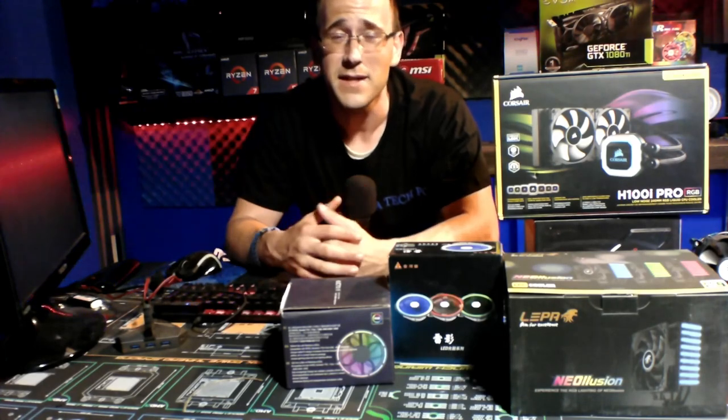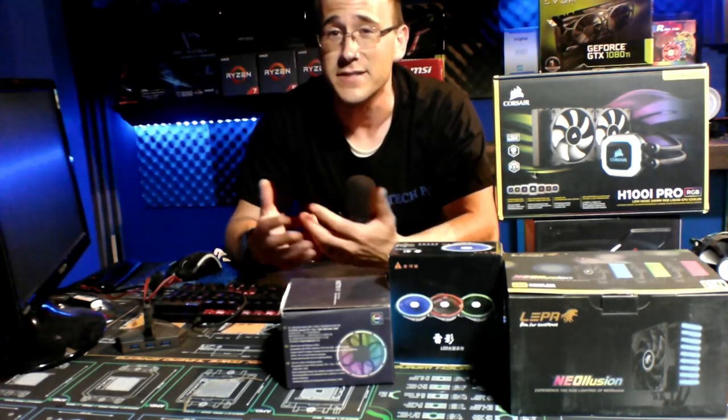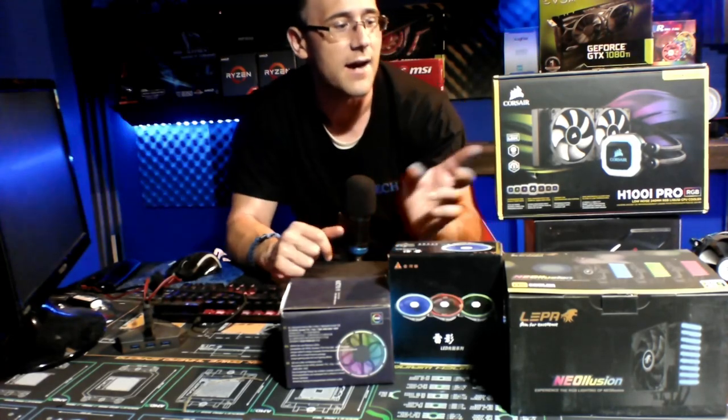Not really, because you can still buy a $50, $40, or $30 CPU cooler and still get the same results. Unless you might be going into, you know, an AIO. But the thing with AIOs is that a 240 millimeter rad will only dissipate so much heat. A 360, or three radiators, three fans, will dissipate more heat. But then you gotta make sure that you have the room for them, and these things are expensive. And like I said, if the pump fails, you're in trouble.